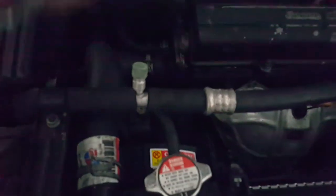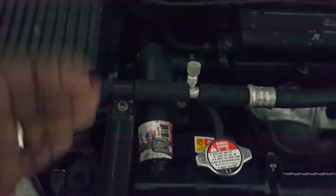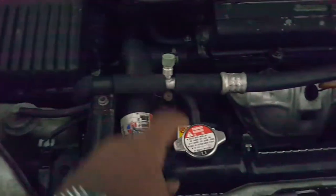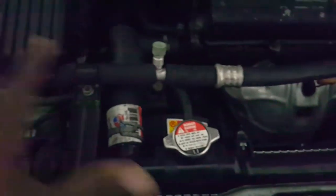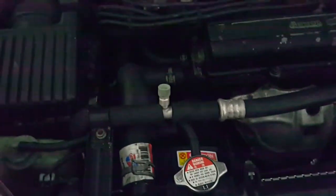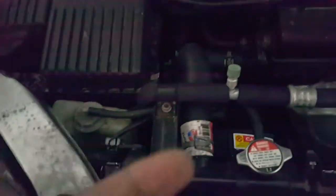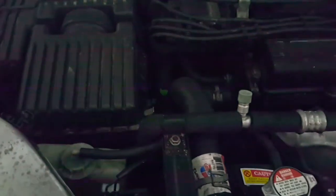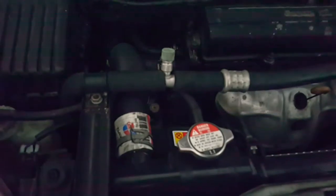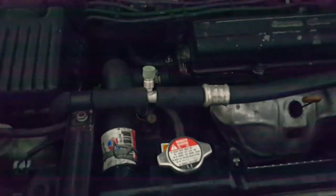This hose is still very hot — I've been home now maybe 30 minutes and it's still very very hot. This is not gonna cool off for another couple of hours, so don't go messing with the radiator cap or this hose or anything like that. Wait for your car to really really cool down. I filled up the water, so I'm probably good for another two to three weeks. Next week I'm gonna be checking my brake fluid and oil, so we'll be looking at those in the next video.